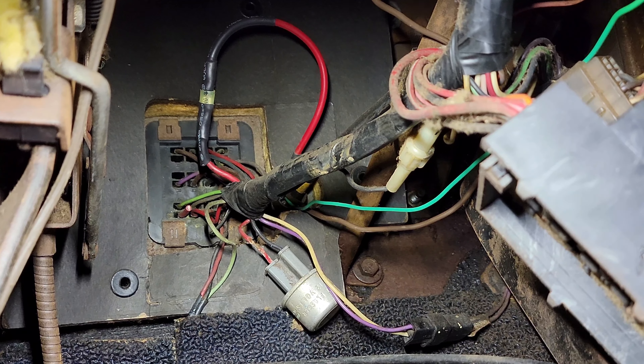I've got that piece of wire loom on it and zip-tied now. That's probably overkill — you shouldn't have to go that far — but being that it's in the area where your foot's constantly pushing against the brake pedal or the emergency brake, I didn't want to take any chances. It's tucked up out of the way under the dash, so it shouldn't have any issues. Fixed the naked wire on the flasher relay, and I did the same repair on the amp meter bypass right there. I just got to put a piece of wire loom over top of that, but it's done pretty much the same way.